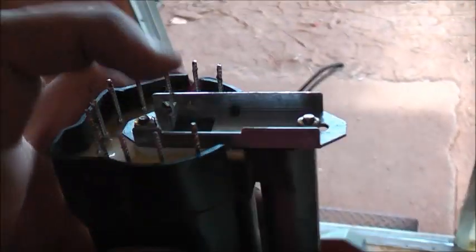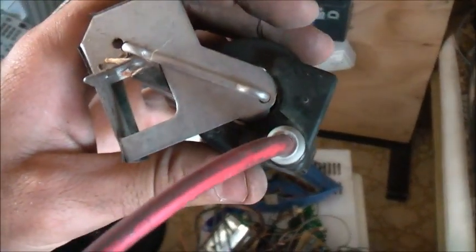It's quite a small one. Okay, I got the flyback off. I like Mitsubishi's technique of securing it. That just twists on and solders onto the board. There's a nice flyback. It's the same size, height-wise, and the ferrite is the same as the one that's in that one. The overall roundness is not quite as big. So the one in there has probably got a lot more turns on it than this one.